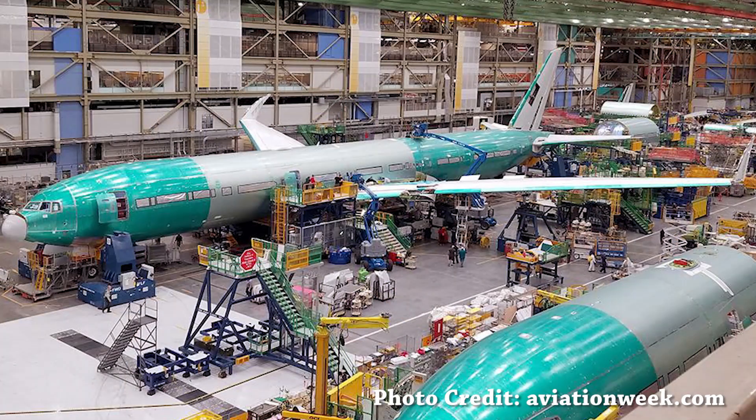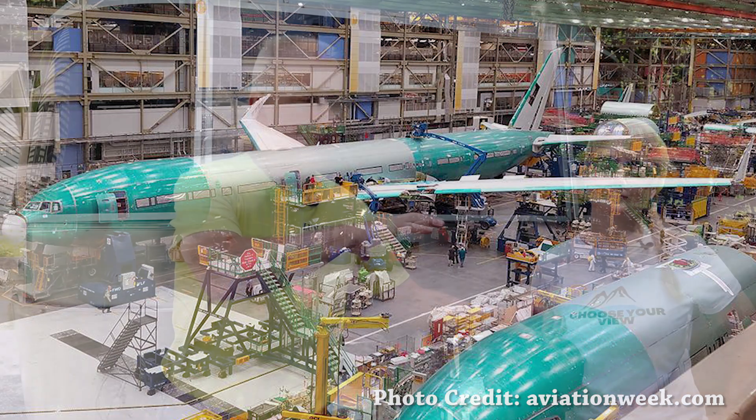There's one other prevention method that the airline industry uses. Aircraft like Boeing 777s are built with a zinc chromate coating applied specifically to avoid corrosion — both oxidation and filiform. It's an extra protective layer, but it comes with the side effect of making the whole product green. That's obviously not practical for a silver Airstream trailer, but it's one of the ways the industry handles it.